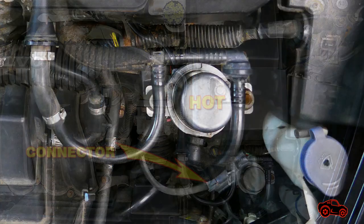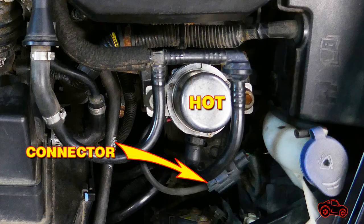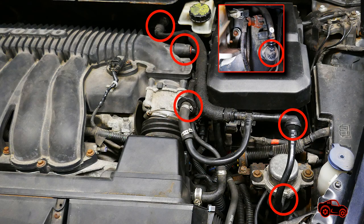The pump was so hot that when I was disconnecting it, I burned one of my fingers when I barely touched it. Usually, when a vacuum pump is running far too long, it means that there's a vacuum leak caused by a defective fitting or by a leaking one-way check valve in one of the hose assemblies.